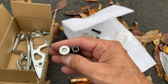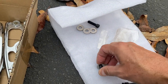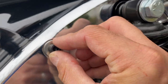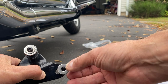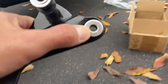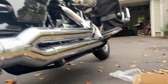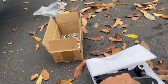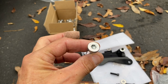That's why they include these washers. The problem is, if you decide to use the provided hardware, these washers will not fit in here. So one option is to take the washer, put it here, and with a small piece of tape on top, glue it — then you can slide it in and thread the bolt in, and the washer will stay in place. Otherwise, do what I'm doing: simply use the Harley original Torx bolts.